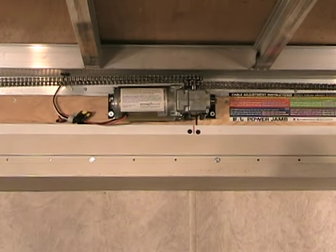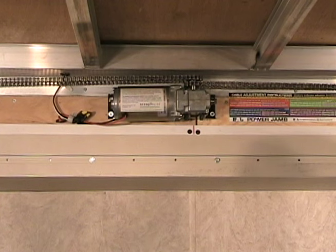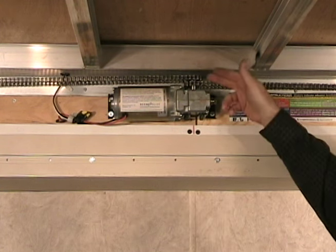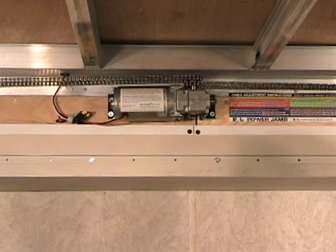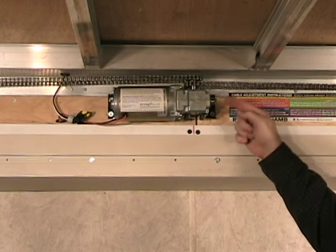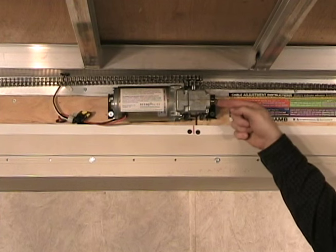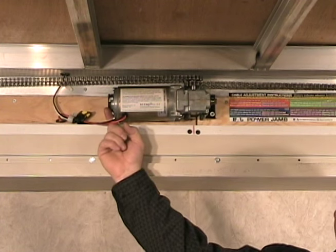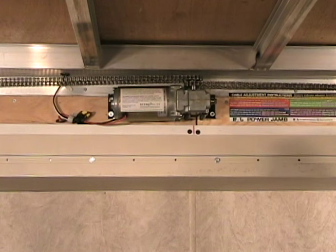The AccuSlide uses two different motors. One is a high torque motor used on larger rooms and flush floor systems. It has a yellow zinc body and an 11-tooth sprocket so it develops more torque for those applications. All motors are worm gear motors and are self-locking, so when the motor is not energized, the room cannot move in or out. The standard duty motor has a black painted body. There's also an emergency override shaft on the high torque motor at the gearbox — it's a half inch — and on the standard motor we have a quarter inch hex off the motor shaft on the back side for emergency operating of the room in or out.